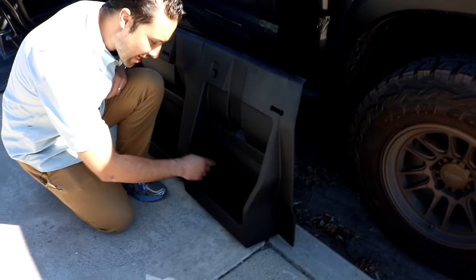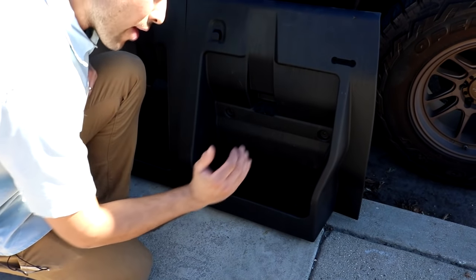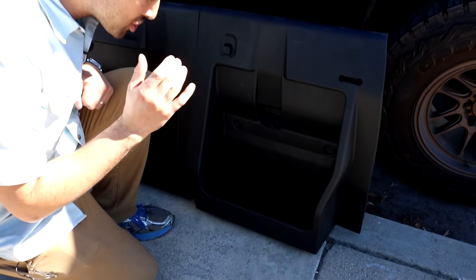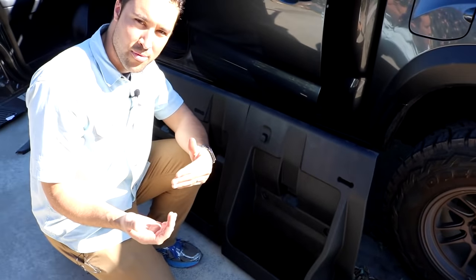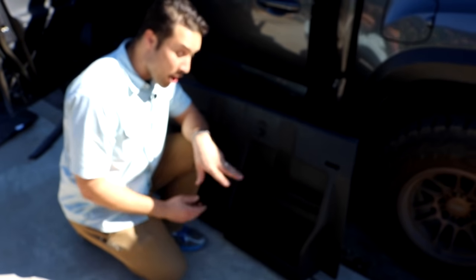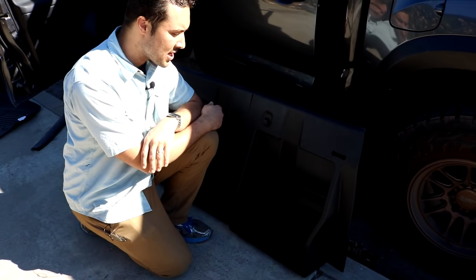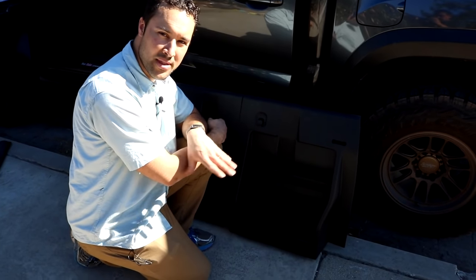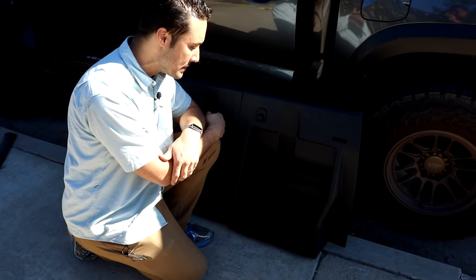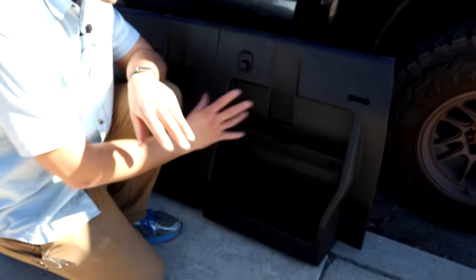Let me show you. On the back side of the panel, we're basically removing this portion back to allow our subwoofer to sit flush. Like I said, they just took an inch away from us, so all we're doing is affording that, but without any compromise to the performance of the sound system. It's not our preference to do the mod, that's why by default you have that single sub option on the passenger side of the vehicle, but for those who prefer the driver's side or don't mind having the dual with that slight modification, that's what takes place. All modification again takes place on the back side of the panel, so once the subwoofer is installed, there's no aesthetic compromise to the interior of the vehicle.